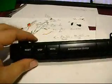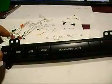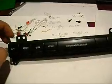The first part, I'm going to go ahead and knock out the upper section. So for that upper part of the console, I got this one out. This one was held with four millimeter screws. You can get a 4 millimeter socket and knock this bad boy out.